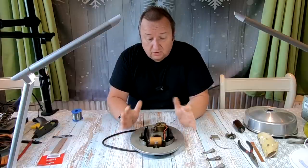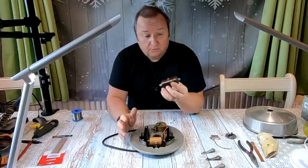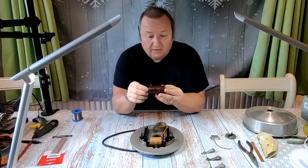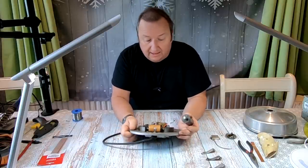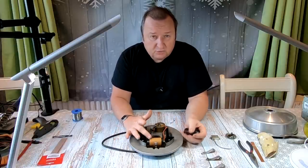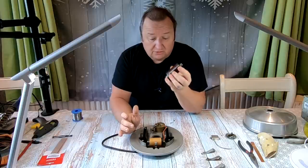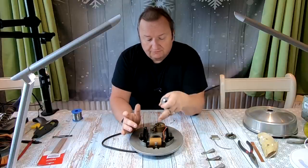As you know from the previous video, we took the coil out and checked it. The coil looked like this one here, which was duff. This is the old original coil and apparently they are renowned for failure. I've got a replacement coil - it's called the long coil, apparently. I didn't know that, but that's what I ordered. What turned up is a shorter coil, and lucky enough it only just fits in there. That cost me 26 pounds. Apparently you can get these rewound and it can cost over a hundred pounds. They don't actually make these coils anymore, so the only option is to go for either a pattern coil or get the original one rewound. So I've gone for the cheaper option - a pattern one.